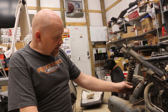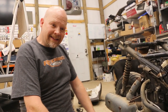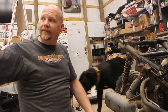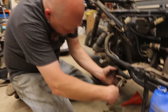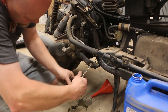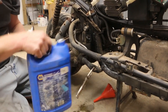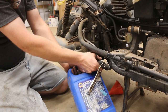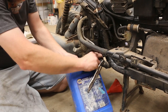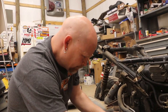One of the things we're going to do is take this exhaust off and I am going to build a custom exhaust for it and make this a little bit louder. We're going to go ahead and pull this. I don't want to make a mess, so I'm just going to take this clamp and clamp down the coolant hose. That way I can pull this off and capture however much coolant is in the engine, and then we'll get the radiator out.